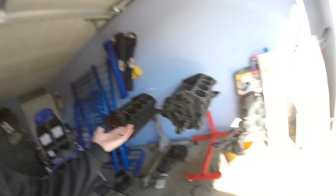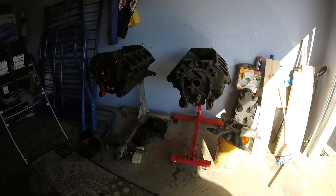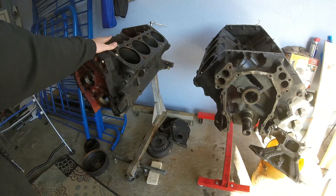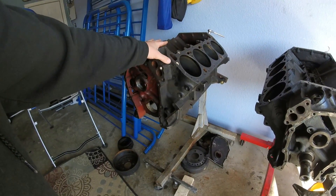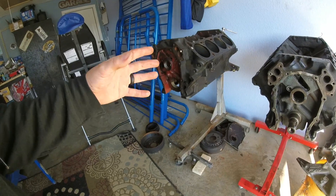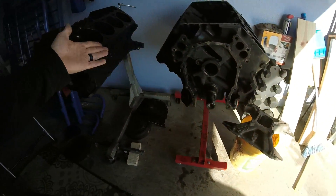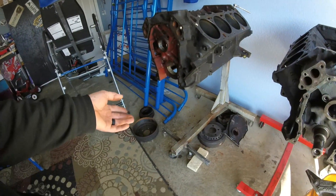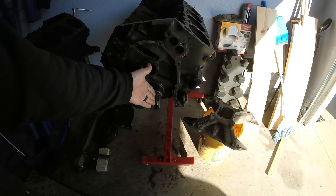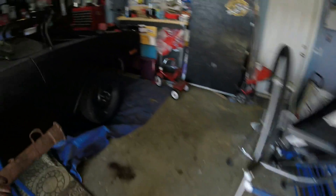My plan with the motors and the 440s is probably 450 to 500 horsepower. This one has already been built up to 10.5 to 1 compression, so I'll probably be rebuilding this one first, maybe even with the cast crank, because it looks like the crank and the pistons were weighted together for a blueprint style — perfectly balanced. So it would be pointless right now to swap the forged crank over to this motor and have to do all kinds of machine work. I will have to get a dial gauge out and make sure the overall thickness on the journals matches the cast crank.